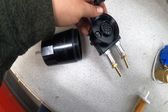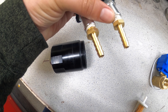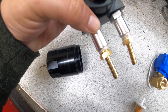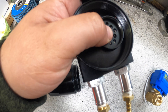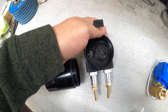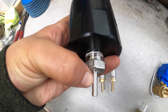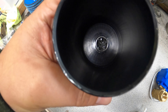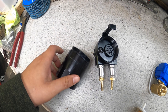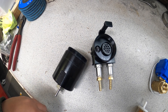I'm going to walk through what I did on the oil catch can. I essentially tapped the fittings for a quarter-inch NPT thread, then used a quarter-inch hose — the one that came with it was too big. I stuffed some steel wool as my filter element on the intake and output. Then I drilled and tapped a half-inch NPT, again with a quarter-inch barb and steel wool stuffed as my filter. I'm going to fill this with charcoal, so that'll be my off-position vapor escape route, which goes through the charcoal to remove the vapor smell.